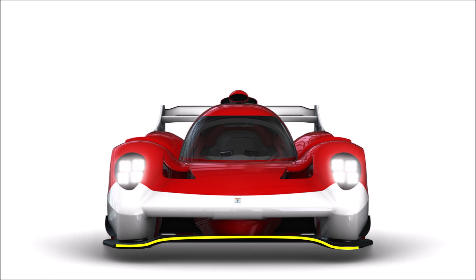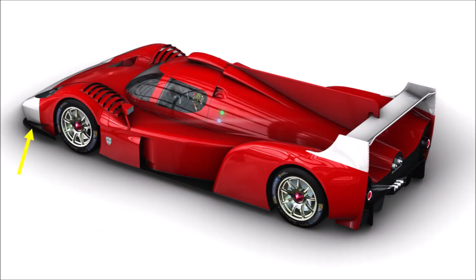We can see a front wing with raised center section to avoid stalling under braking and we can also see flaps, but their width is limited due to the wider nose. There are outlets on the front bodywork to release air off the front of the car. At the side we can see small flicks. They create some downforce and longitudinal vortices along the front wheels to suck air out of the wheel arches.